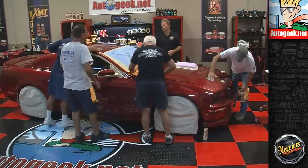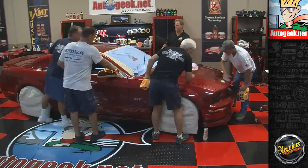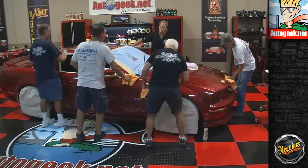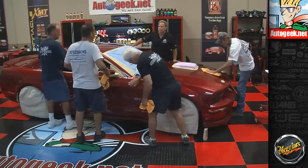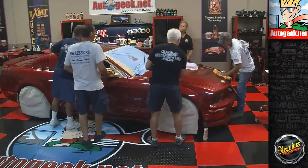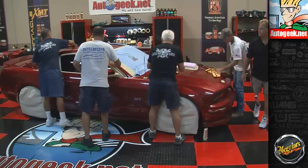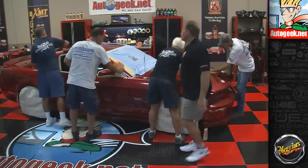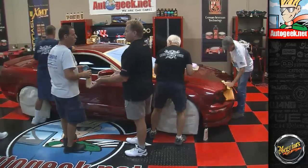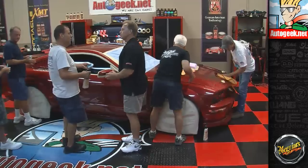If you're going to buff it out anyway, you might as well just clay the car and knock any kind of issue out of the park and get it done and over with. If it's a show car that's maintained regularly and garage kept, and all it gets is a coat of wax, then a wash and a wax will be fine. Sure. But most cars aren't garage kept 24/7. The only other time you wouldn't clay a car is if it's one of your past customers. Right. But you'd still inspect. Well, at 6 months I'll reclay a car. And if I apply wax every month to a car, then no, I won't.